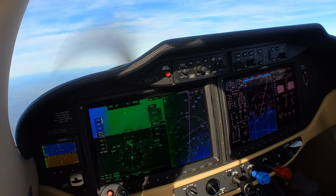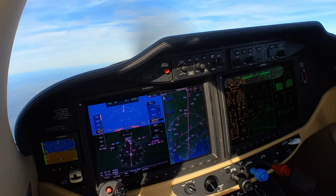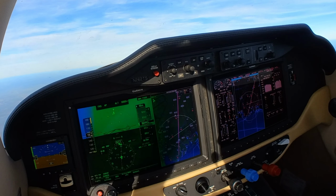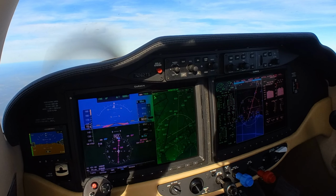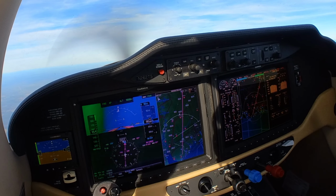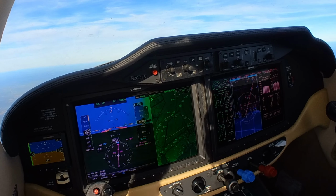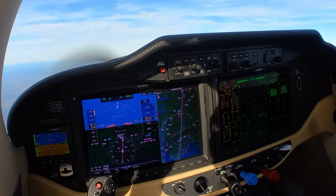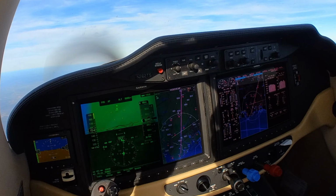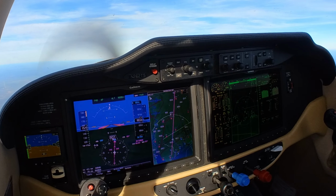Then in the bottom below the panels, you'll see one of the engine controls. From left to right, we have throttle, prop, and mixture: black, blue, and red. And then various other settings and controls. The touchpad took away a lot of the panel switches. The air conditioning and heat and all the environmental controls can be controlled by that. All the frequencies for the radios, and gosh, a million other things, flight plans, procedures, everything is there and can be punched up by the control panel.